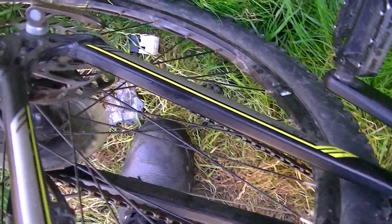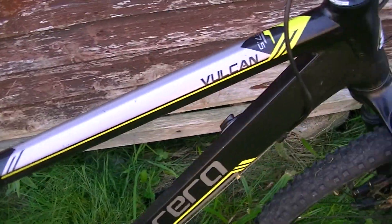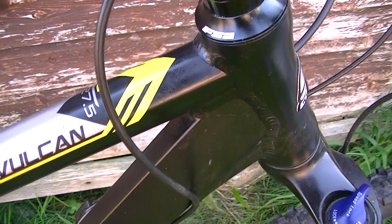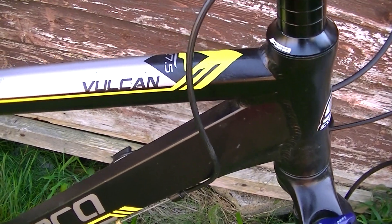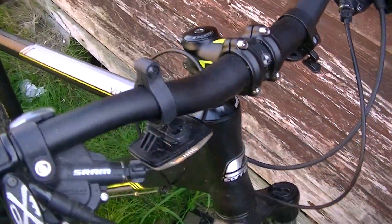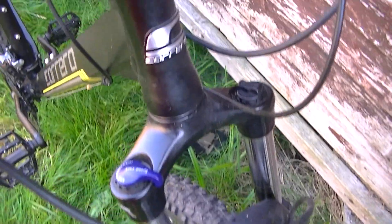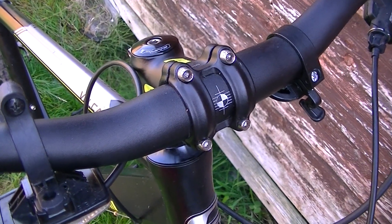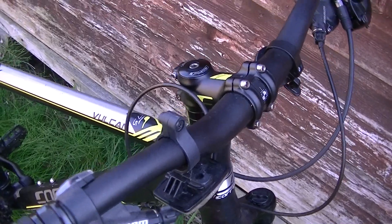It looks pretty typical to all Carreras ever made — they haven't really changed the styling much in recent years. The geometry is pretty steep; I don't know the exact head angle, but I suspect it's around 69 degrees or so. A more modern bike, like a Marin or a Norco Torrent, is going to be around 64.5. The slacker bikes don't wheelie as well because the fork sits out more to the front, putting more weight over the front end. These older-style bikes do wheelie better, but they don't jump as well and don't handle drop-offs and certain cornering as well. But for the price, you can't really complain.